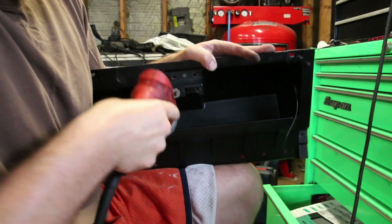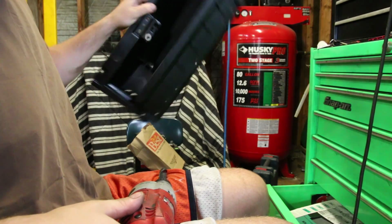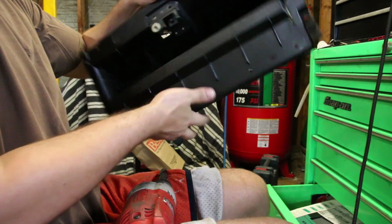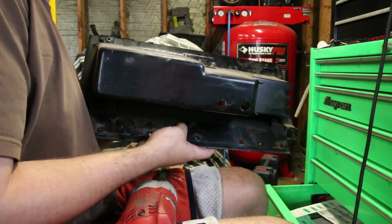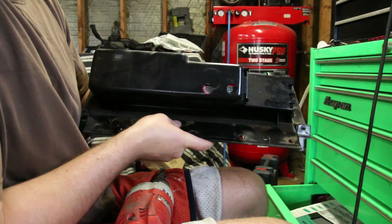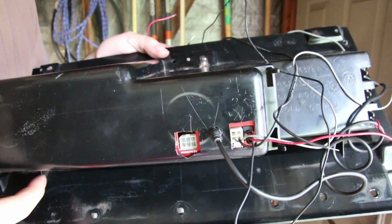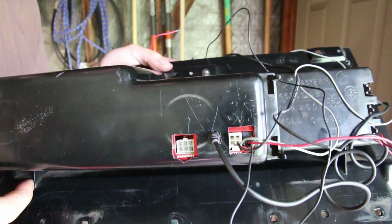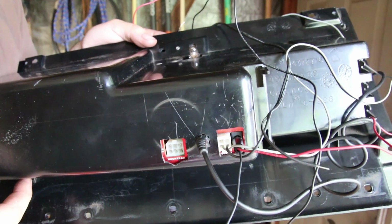But nonetheless, we got two 3/4-inch holes, roughly where they need to be. We'll add another one later for the line to transmit to the wideband gauge itself, and we'll be all set. I do go ahead and clean these up, make them a little bit more square so that everything fits. There she blows. We've got all of the wires and cables we're going to need hooked up into the glove box. We just need to go ahead and get this thing secured.